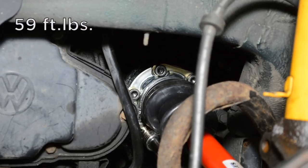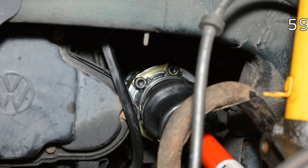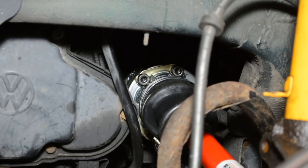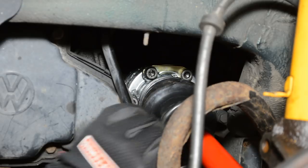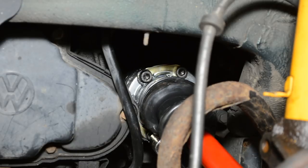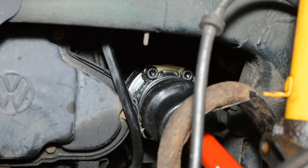The torque spec for the axle flange bolts is 59 foot-pounds, so that's where your torque wrench will come in. I did have a little trouble with the Allen driver — the base was kind of large and it interfered with the boot. Maybe if you go from the top of the axle instead of the bottom like I did, you'll have better luck, but I found it easier to tighten everything from the bottom, so leave a comment and let me know how you did it.